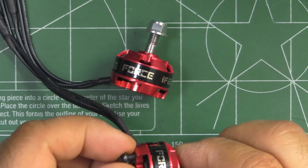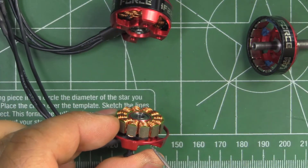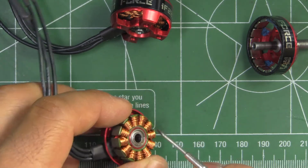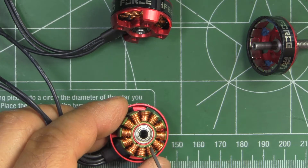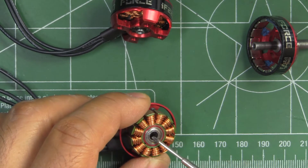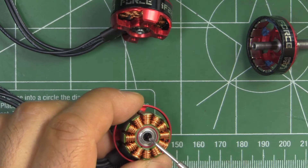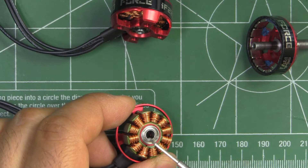Let's go over them quickly. It has 0.2mm laminations on the stator. They're saying these are genuine NMB Japanese bearings. They do have the NMB markings and they look pretty good — I didn't see anything fishy in there. I'm thinking these are genuine; they look pretty much like all the other NMB bearings I've seen on DYS motors.